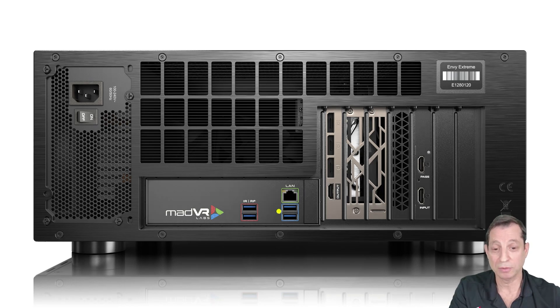Now let's turn our attention to the USB ports. The first two on the left are for RF and IR — there's an RF dongle we saw during unboxing, and an IR dongle that comes standard installed with the unit. The other two USB ports can be used for keyboards, which is useful for naming profiles, calibration LUTs, or using the keyboard as a remote when wireless is unavailable. One USB port is also useful for powering active fiber cables that need power at that end.